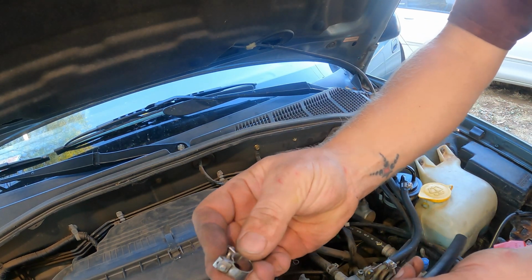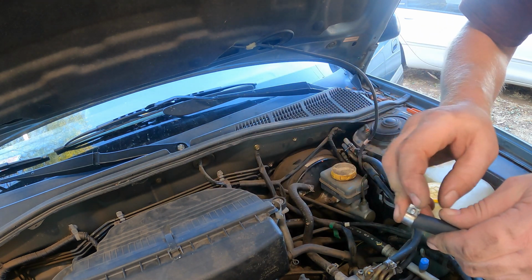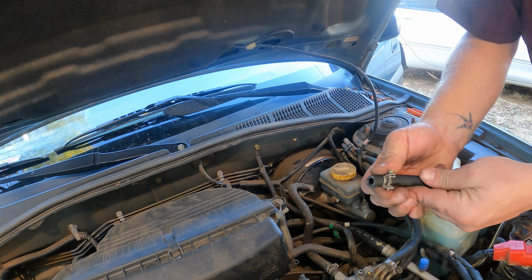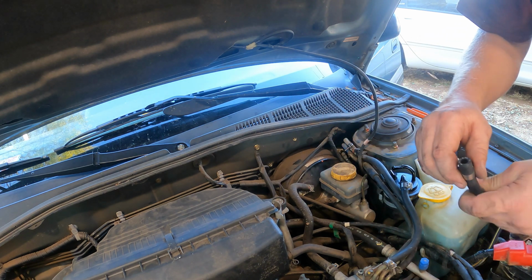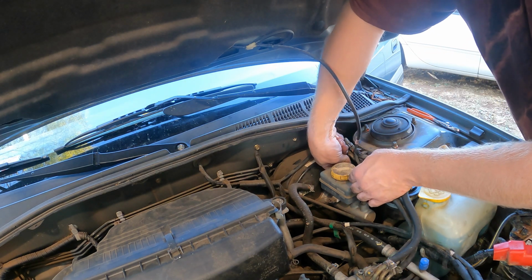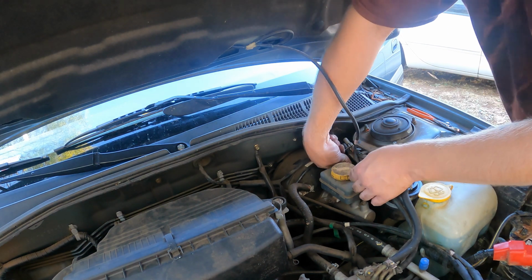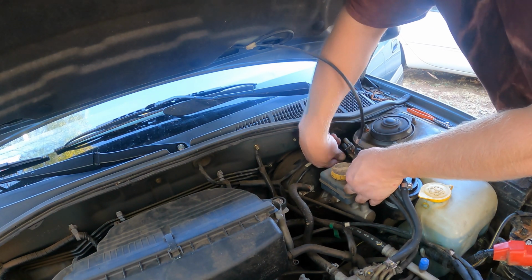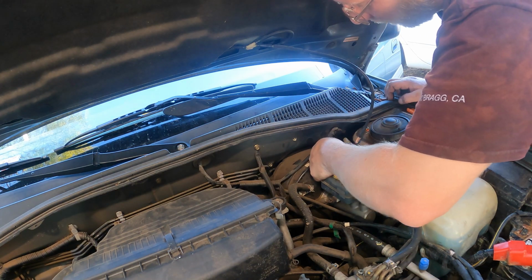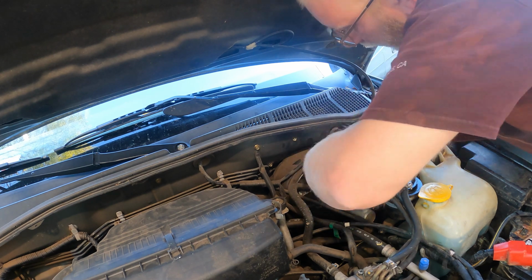Make sure you've got these clamps. These are fuel injection clamps, high pressure clamps that you need for high PSI systems, not those worm clamps. They might get you by for a little while, but it's not recommended. And this is 5/16 fuel injection line. Also, make sure you get the right kind of line. Most stores will sell carburetor worthy and then high pressure fuel injection worthy.